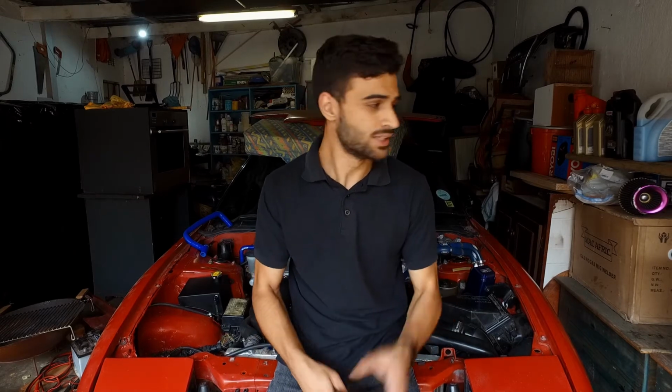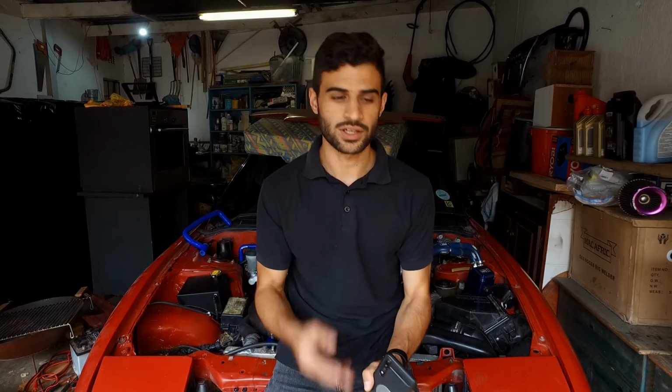Okay, so as you guys saw, it drove. It wasn't the happiest chappy ever. We definitely need to get those engine mounts done. So today we managed to go and get the high tensile bolts from Robot Hardware. Next we're gonna cut the plastic sheeting off of the actual mounts themselves. We're gonna drill through the hole where the plastic is in there and we're gonna get the top and bottom painted. Hopefully we can get the engine up and actually get those bolts loosened. Remember, we couldn't do that while we were trying to take the engine out.